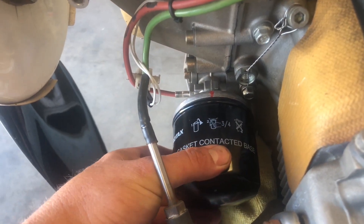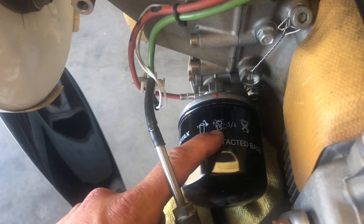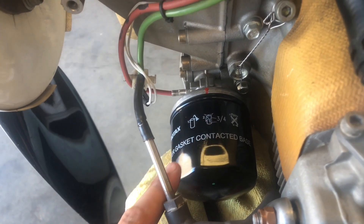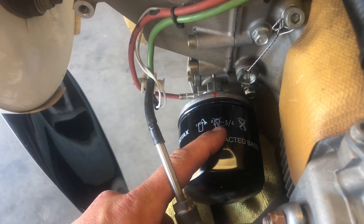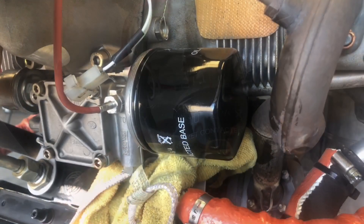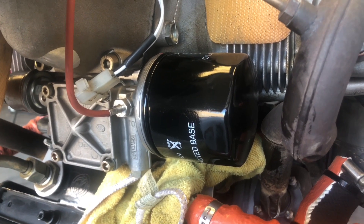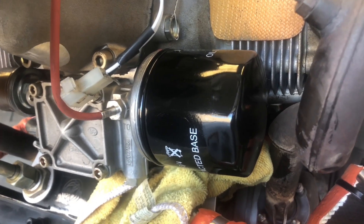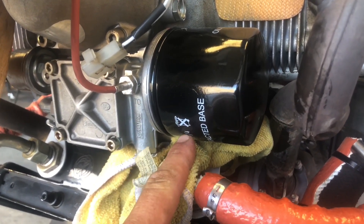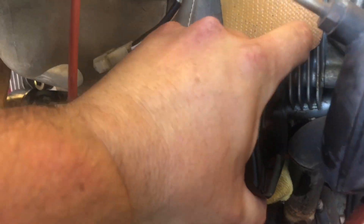The filter has now made contact with the pump. We have the logo of the hand touching the oil filter in the 12 o'clock position. We are now going to further tighten the filter so that the logo rotates around to the 9 o'clock position. The filter is fully installed — I have it as tight as I can go by hand. I think I had actually tightened it a little past seated because we didn't come quite up to the 9 o'clock position in reference to the logo, but there's certainly no way of getting it any tighter.